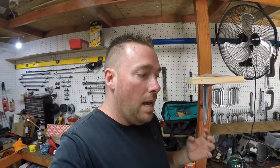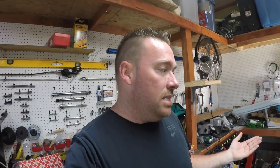And on the cars that have a lot of wear on the valve body, this seems to help out a lot. And we've had cars that we used the ZF or the Pentosin or whatever fluid you want, and it's real thin and they wouldn't shift right with it in higher mileage situations. With this stuff, it seemed like it does better with the seals, does better with everything on it, and we never had an issue.